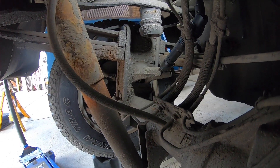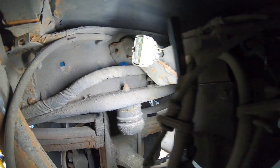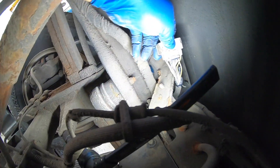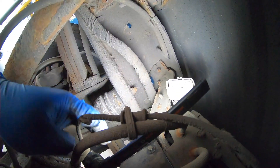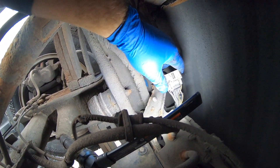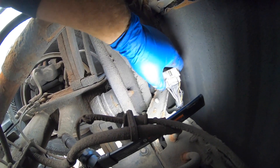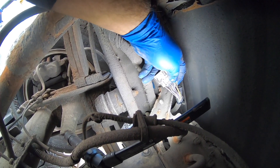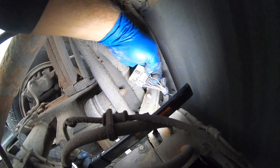Whether you're having to lay underneath or drop the tank — which I did yesterday with an empty tank, now it's full — if you drop the spare tire you can literally sit on the ground and unplug everything up top. You can see here's my plug that's unplugged — that's why I've got five codes. When I was fighting with this thing trying to unplug it as I lowered the tank, this line kept getting twisted and what I found is there's a very little crack in the wire.